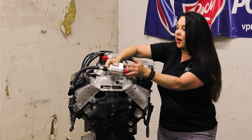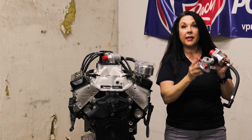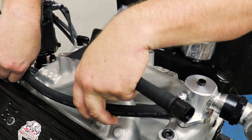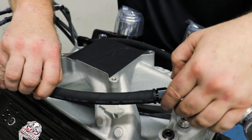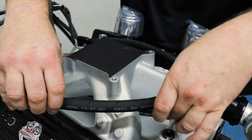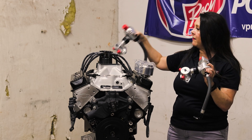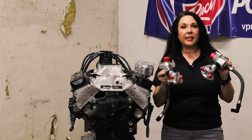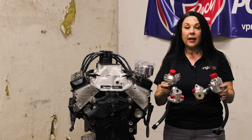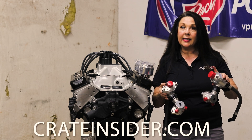We put the bolts in, and then on a 604 — big difference between these — with a 602, you're not going to see these inlets back here at the back, because with the 604, we're going to use our intake manifold water lines in order to connect to this system. With a 602, you don't have that, so you don't have to worry about that, so we have slightly different systems. I also brought another one out here. You have different options, so whether you have a 602 or a 604, and then what you want for your water outlet going into your radiator — we offer this as a dash 16 or as a dash 20.